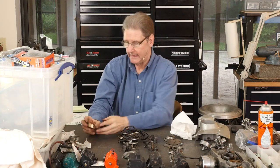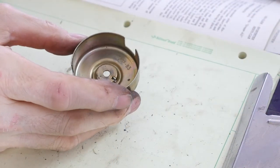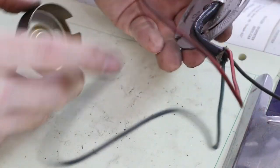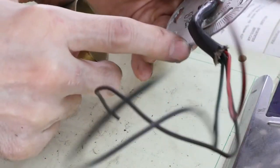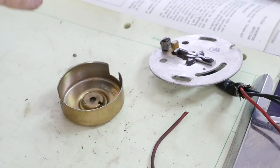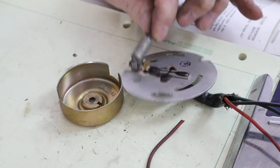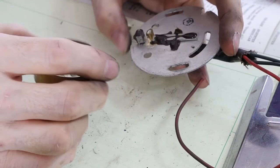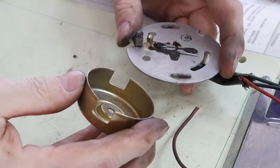So then finally, I think it would be 1980 — the modern thing — which is this little cone. And see, there's no electronics here, there's just this sensor. They even try to help you with the degree wheel. This one is magnetic, so it's Hall effect. Some of the aftermarket stuff used optical. Optical running hot — the LED inside wears out, not as good. I think Hall effect is just more robust. And this is all that's in your cone.